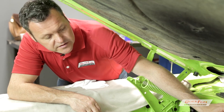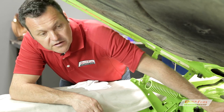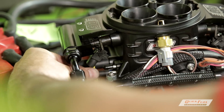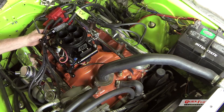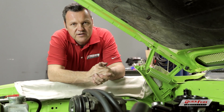The kit requires that we run a vacuum line from the throttle body into the ECU. We're going to mount the ECU inside the car on this installation — it can be mounted on the firewall, but we decided on a nice place under the dashboard. We ran this vacuum hose from the firewall and we're going to hook it up to the throttle body on this lower port. If there is a vacuum advance distributor, you'll want to run new vacuum lines, mark them, and make sure you replace them in the same locations they were previously.